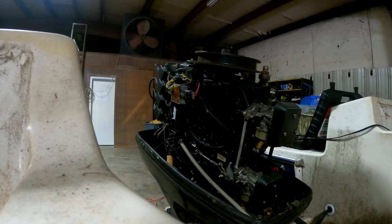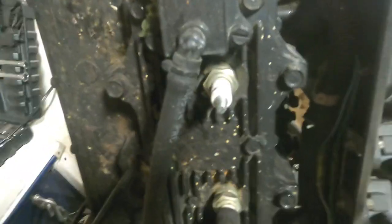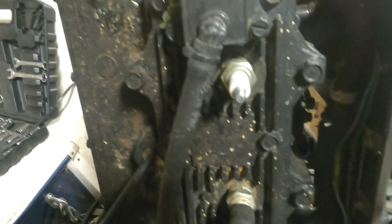We're almost there. Corrosion issues in the grounding wires and other connections are proving to be the problem. Let that battery charge up a little bit more. You can plainly see this is a four-cylinder right — one, two, three, four spark plugs — and we're going to check each one of the spark plugs.